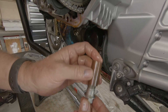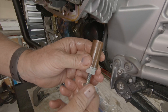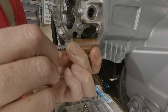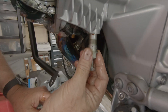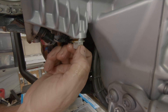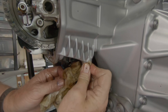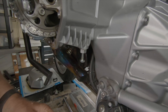We put this in here. This is a 42 millimeter long sleeve used for pre-positioning the plunger inside. Right now it's sticking up above the level of the sleeve. Using the machine face of the cylinder head — when it's sticking out too far it rocks back and forth; when all three points touch at the same time you remove the sleeve. It's pre-positioned at the right length. Put this into the opening where the cam chain tensioner was, don't disturb the relationship of the bolt to the body, and thread it in by hand all the way until it bottoms out on the cylinder head.